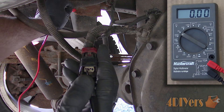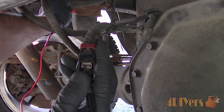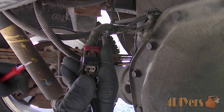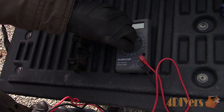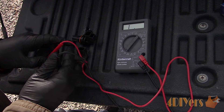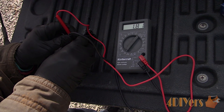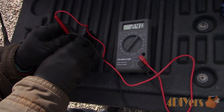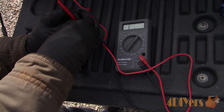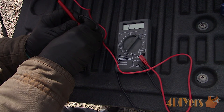As an additional test, you can also jack up the rear of the vehicle so the wheels are free, then spin them and measure the voltage at the sensor — this should produce a small amount of voltage when the axle is spinning. If you are having trouble accessing the sensor, it can be removed and you can do the same ohms test right at the sensor. Other times the sensor can be in good condition but built up with sludge, and it can simply be cleaned using a sensor-safe brake cleaner, then reinstalled and it will be working correctly again.